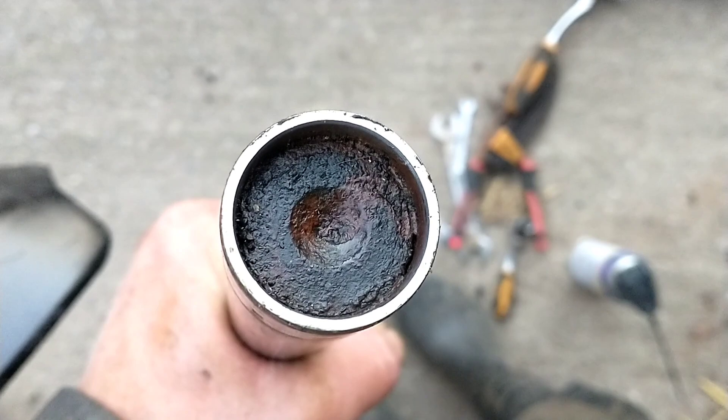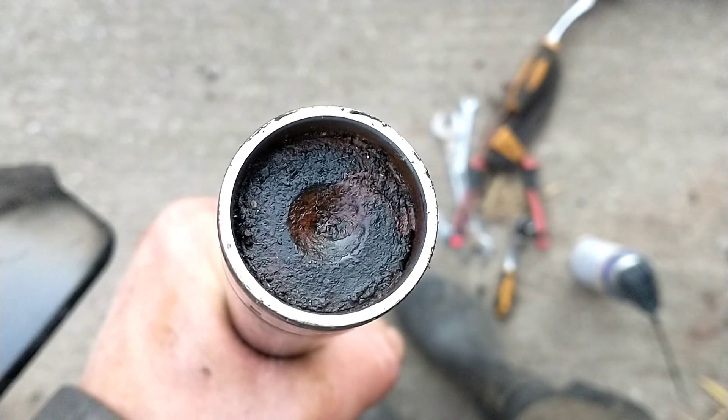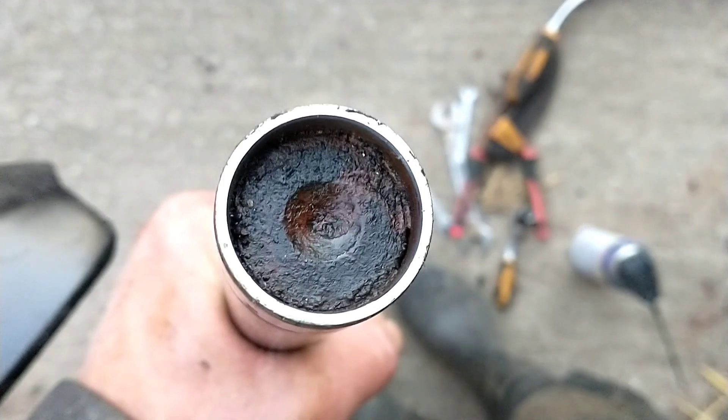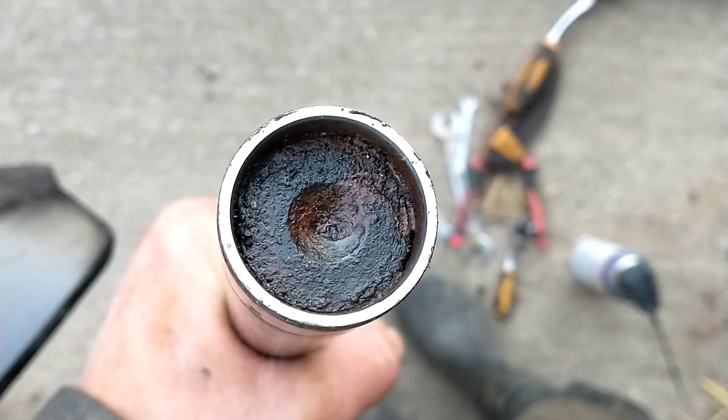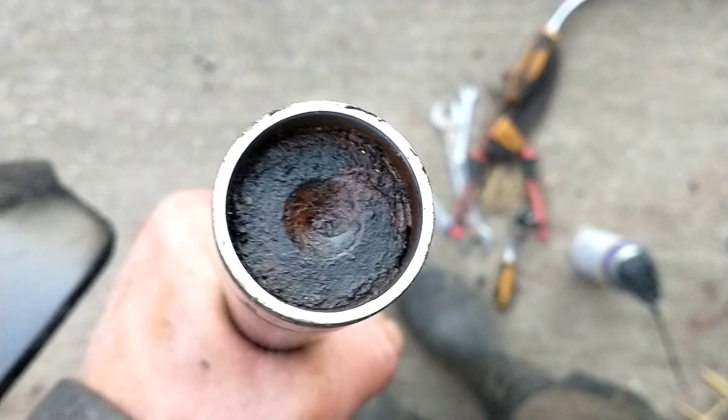This is the top of the leg. The end cap has to be pushed in, and then the C-clip taken out — this is tricky, two man. Take the springs out, clean and refill with fresh oil. Then push that cap back in and put the C-clip back in.